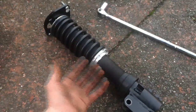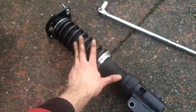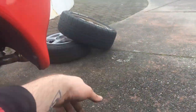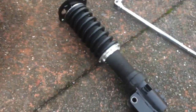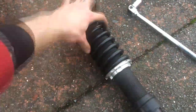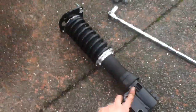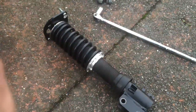The only way to contact them was through Jesse Streeter. I got these because they're height adjustable, so I could drop it down or adjust it. Right now I have it adjusted as high as it goes on the rear because I'm using the 185/55/R15s. The biggest difference between this and the stock ones is that the piston in this is almost the same size as the sleeve right here - it's so massive. I'll try and find a picture and post it here. The build quality on the Silk Road coilovers is amazing, just not for the street - it's definitely race only.